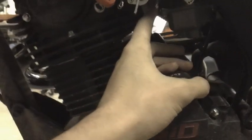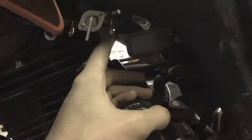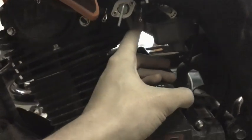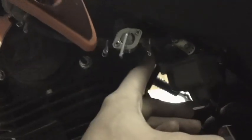Yeah, awesome bikes. You go like 4 hours on the tank, it just sips gas, and it comes with a little key, you turn it, and then you can start the bike. Just press that and turn the throttle a little bit, and you have to have the choke on too. This bike actually, wait, I think the choke might, oh there it is. It has 2 settings. The bottom one is for when the bike's been running for a little while. You run it on middle choke once it's running, and this bike actually likes the middle setting more, because it likes more RPMs, I guess, because the carburetor's finicky. But anyway, that won't hurt the bike.